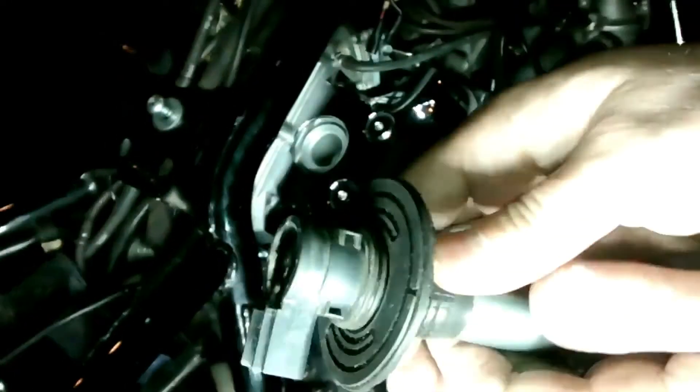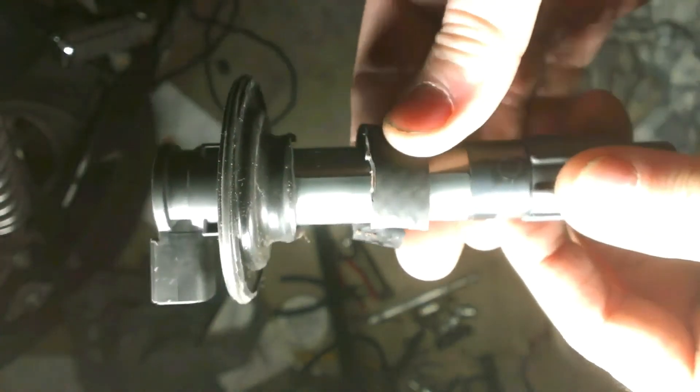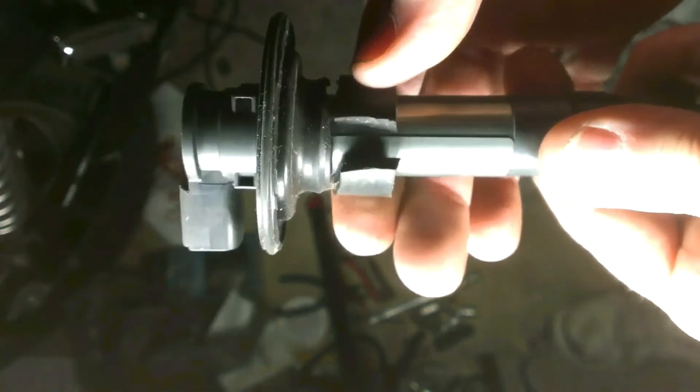This lip snaps into place and acts almost like it was made for it. One last thing: on the Ford COP seal, I had to trim it down. Here's the trimmed version — when installing this in the cylinder with the vibration dampener, the untrimmed seal would push over the snap. By trimming it down, everything fit nice and flush. I trimmed it right above the first rib.